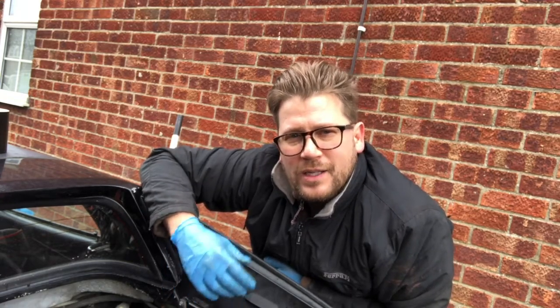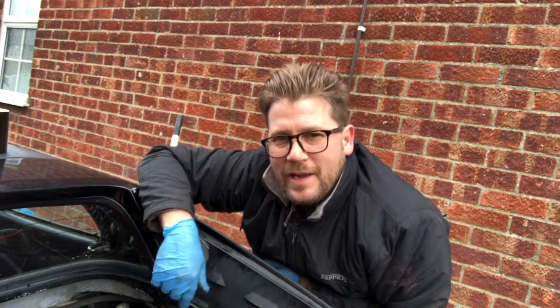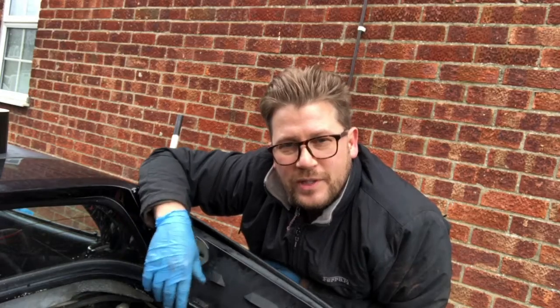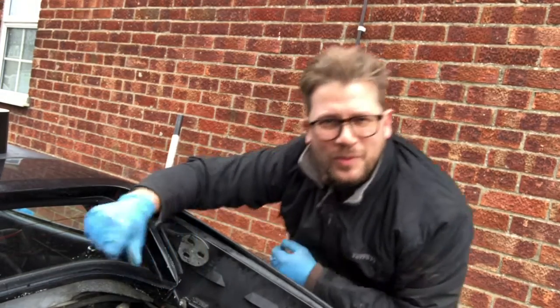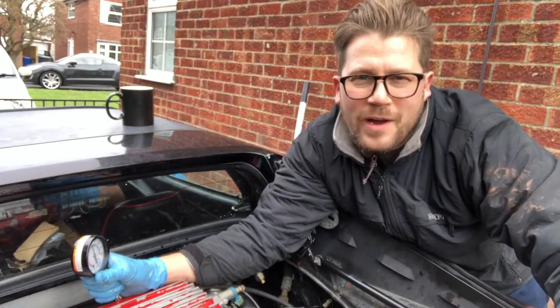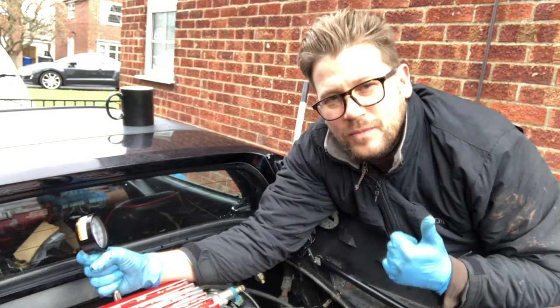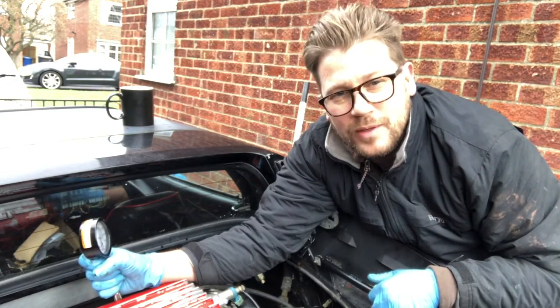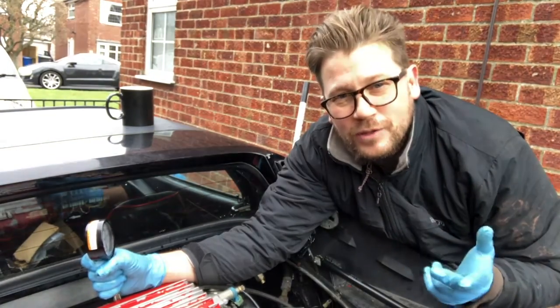Now for the big one — we're moving on to the rear bank. My gut feeling is it's not going to be good. Normally in a movie we'd cut to commercial to keep the suspense, but let's just continue. Second cylinder — guess what — about 178! Really, really cool, probably the highest cylinder out of all of them. Two more to go, keep those fingers crossed.